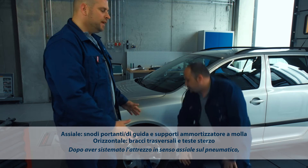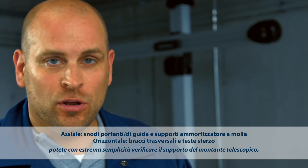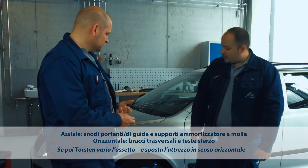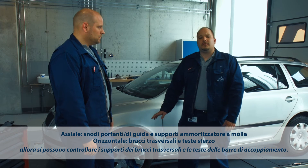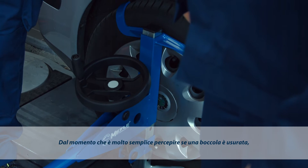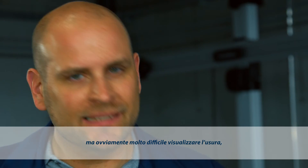When the Joint Play Tester is secured axially like we've done here, you can easily check suspension strut bearings, ball joints, and the lower bushings. If you wanted to check control arm mounts and tie rod ends, all you would have to do is position the Tester horizontally. It is very easy to feel whether or not a bushing is worn, but obviously difficult to see.